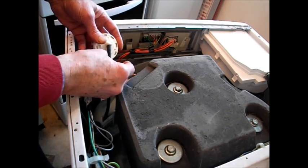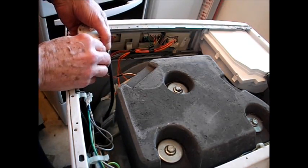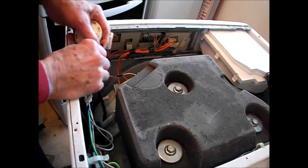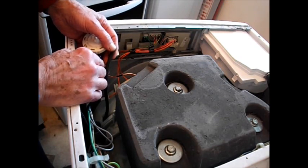When you pull it off, go down the tube and have a look for any perishing by bending the tube over, and check it for blockages. Because if the tube's blocked, that is probably your fault if it's overfilling.